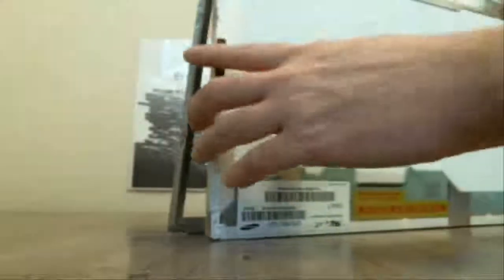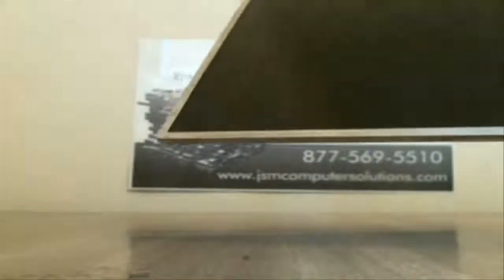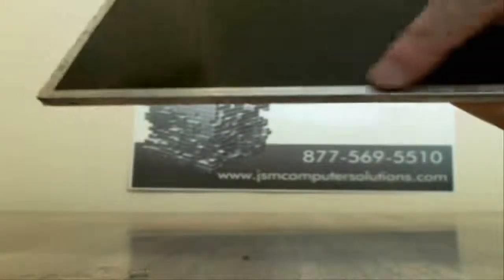What you want to do here, same thing, use the screwdriver and pull up on it. Take your screwdriver, get it down low enough here, and just pry up on it just a little bit, and then it should pop right off. So you're going to run it all around if you get stuck. The reason why you want to pull up just a little bit is because otherwise it will start taking out the actual metal from the LCD. And there is your LCD taken apart.